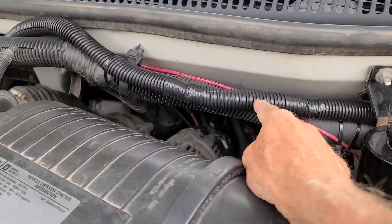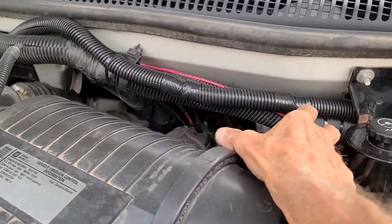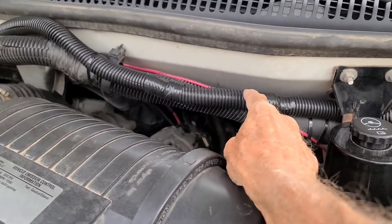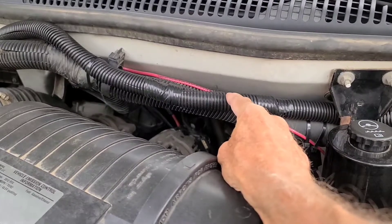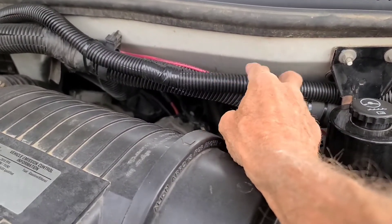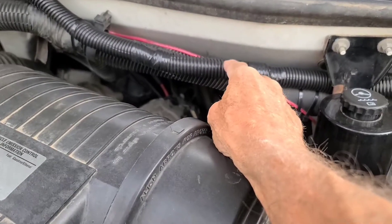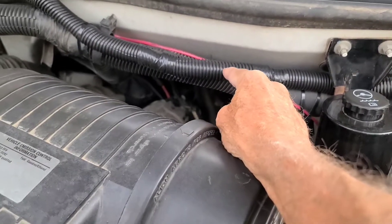What I found was that this was a bad location for it, because if the heat of the engine got up high enough, it would trip the circuit breaker just from the heat. So this was a bad location — near the top of the engine compartment, it was susceptible to all the heat from the engine.